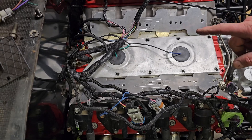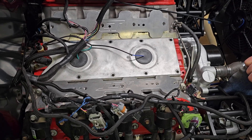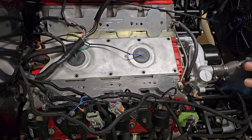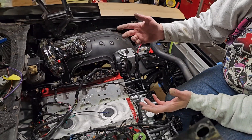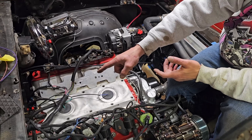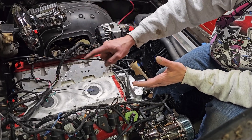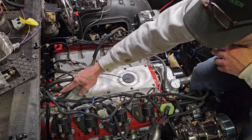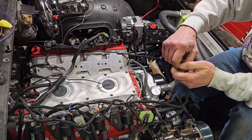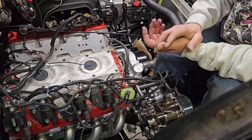The oil pressure is kind of weird — your ECU does not see oil pressure at all, that is completely separate. Your gauge, whether it's the factory gauge cluster or a Dakota Digital like in this case, uses its own sending unit. In this case we have our Dakota Digital sending unit in the back, and before the intake manifold goes on we'll route those wires in the factory harness. Once inside the car we'll branch off to our gauges using the same hole.